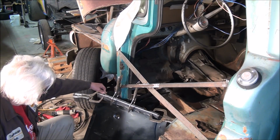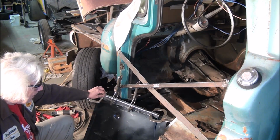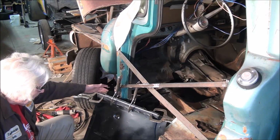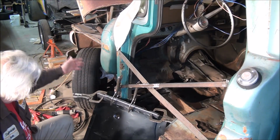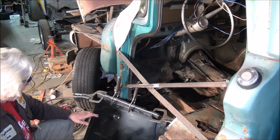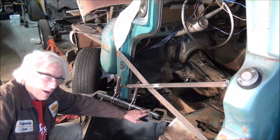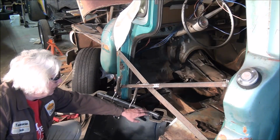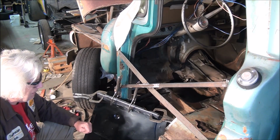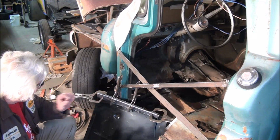And then I went ahead and cut this to length and took it over and started a brake. Could not finish the brake because my box and pan really isn't wide enough for this, and my regular brake won't do box and pan style braking, which is what you have to do to make this complete. And so I had to hammer and dolly to finish the brake. Cut out the relief right here for the fore aft body mount, and then did a test fit and found out that I was probably just about 1/8 inch long. Missed it by that much.